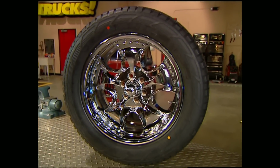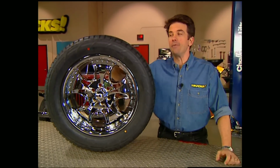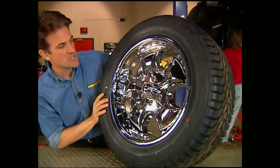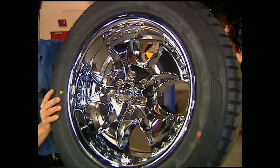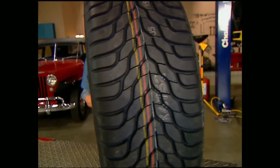While Stace finishes putting the brakes and torsion bars back on, I can go ahead and show you the wheel and tire combination we're going to run on the Durango. Now keep in mind, you need at least an 18-inch rim on this setup for clearance, so we made a call to KMC Wheel Company and had them send us these very slick-looking chromed aluminum Venoms. Of course, those are going to be wrapped up in these 255/55 Yokohama AVS radials.